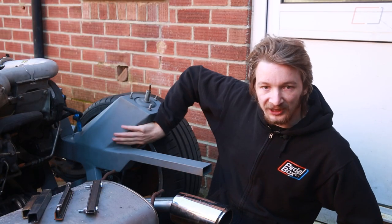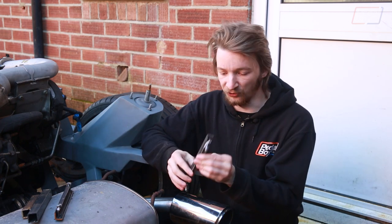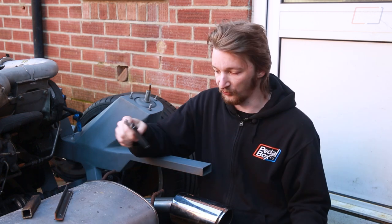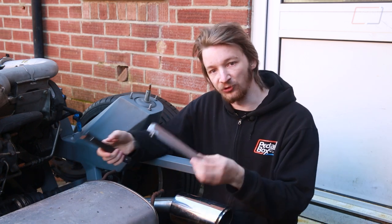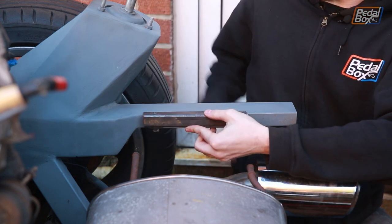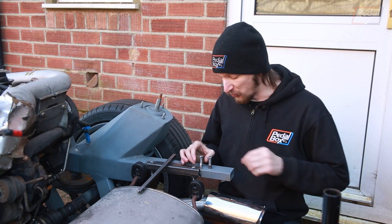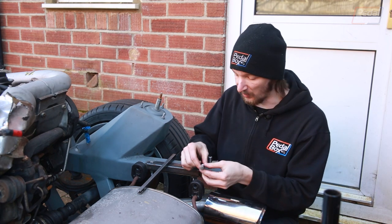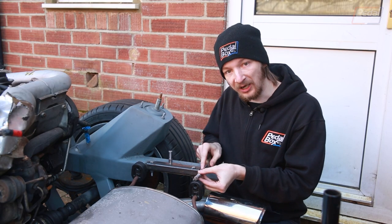Now that we've done the cosmetic work of cleaning up the backs of our towers, we can move on to actually hanging the exhaust. We've made up a couple of brackets — a two-part bolt-together bracket made of a piece of box section cut down the middle into a channel with holes through it to bolt into, and we've cut two faces off of some much thicker box section to use as the actual removable bracket. The part we cut in half welds onto the side of the body, then we bolt on the top section which is going to contain the hangers the exhaust will hang on to. Adrian was turning down some pieces of metal rod for the hangers. We've got little rubber hangers — fairly standard one-size-fits-all things — and we're going to pop these through the rubber and run some half-inch box section from the hanger onto our bracket.